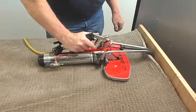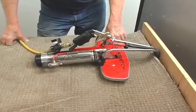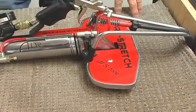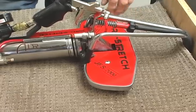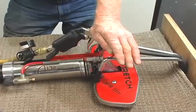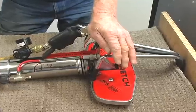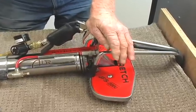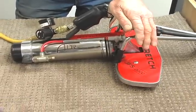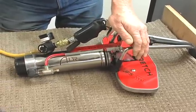Like a pull stretcher, you don't have to position your pulls and try to get three or four stretches out of one pull setting — these are so easy. These will go to 1,160 pounds of push. One of the mills has shown in their tests that pull stretchers produce around 1,200 pounds of push, so these are right in line with pull stretchers for power. But they're so user-friendly compared to those, and the air is doing the work for you — even on the heavy pulling, the air does all the work.